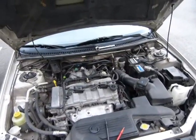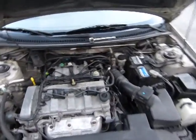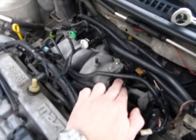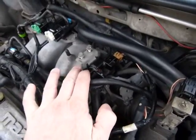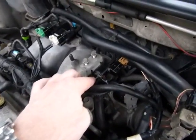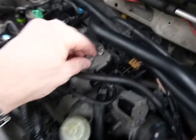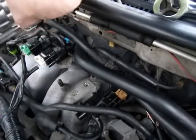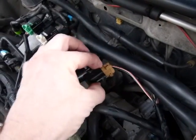On this Mazda I got a code P1250. According to the code and the manufacturer, the problem is with this little unit — the PRC, pressure fuel pressure regulator solenoid control unit. I put a 10mm wrench on it and I can remove these bolts super easily. I've already cleaned these vacuum hoses around and have partially removed this plug.